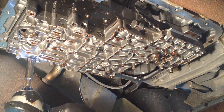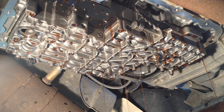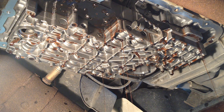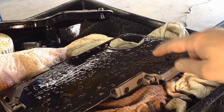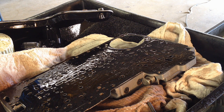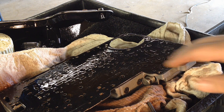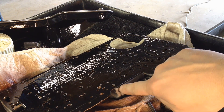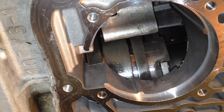Pull the 10mm bolt and you'll see it really drop. That is the reason I leave that center one in there. Once your valve body is down, you can see the separator plate right here — this is a really good place to look for metal also, especially brass bushing shavings. They'll be all over right here on top of it. Give it a good inspection on both sides. Just don't flip your actual valve body over because it has check balls inside, in case you're reusing it.